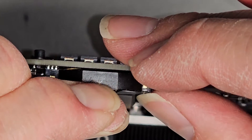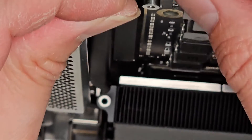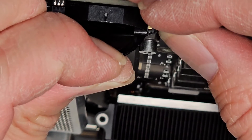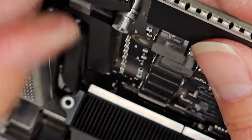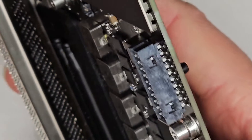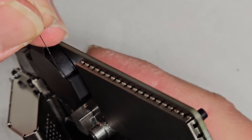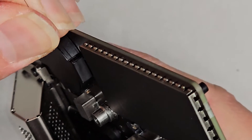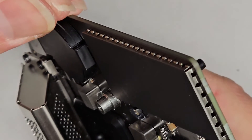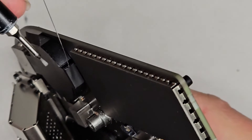Once you get that, you can actually peel this whole thing up. The other side here will also peel up. They actually wrapped it around on three sides, so we're going to peel up the other side as well, again using the acupuncture needle. Same thing — get underneath that little corner there. You can see we can get the needle in, work our way down a bit, form a gap, and get the flathead screwdriver in.